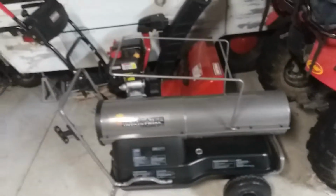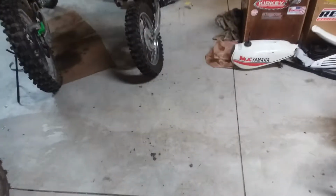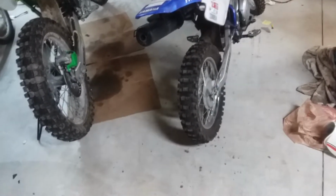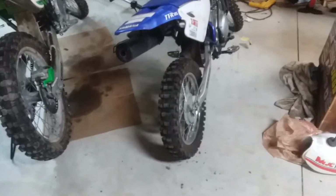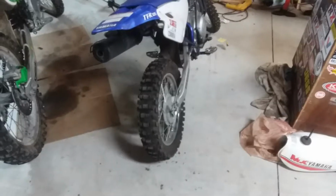To start off this video, if you hear the noise outside, I don't know if you do, but it is my Predator 212 running out there. I have it running because I haven't started it in about 3 weeks, and I'm supposed to start him about every month, let him run for a while. So that's what I'm doing with that. I usually let him run for about half hour, 40 minutes, just on idle.